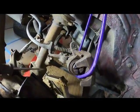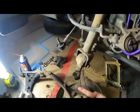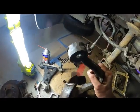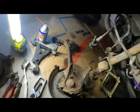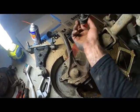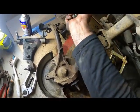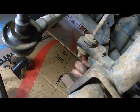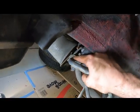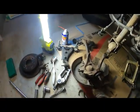Everything in general looks dry so it definitely needs replacing. There's the ball joint here, the ball joint here, the lower one, and the tie rod end — and there's the hub assembly. It's already removed and we can work on it outside the car. We might need to replace this one too, although it looks okay — you never know. This one is definitely the dry one I mentioned but it's an easy fix. And this is basically the sway bar end link — those rubber bushings need replacing as well. We are on top of it.